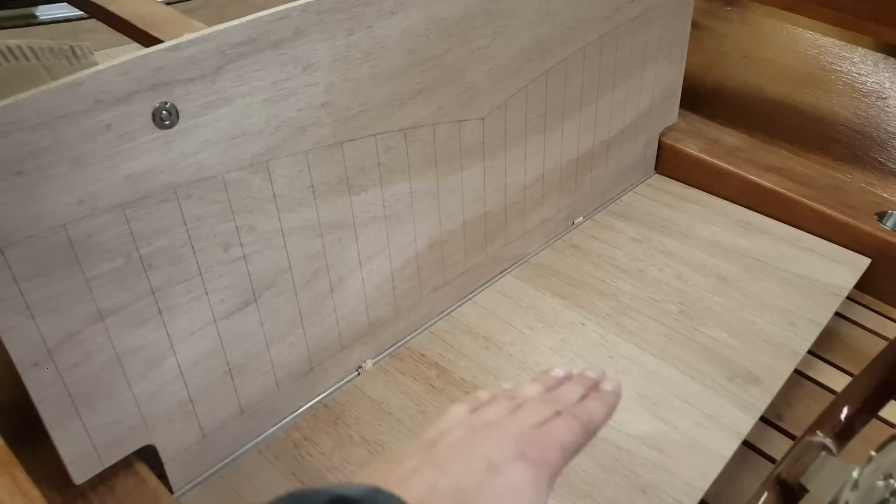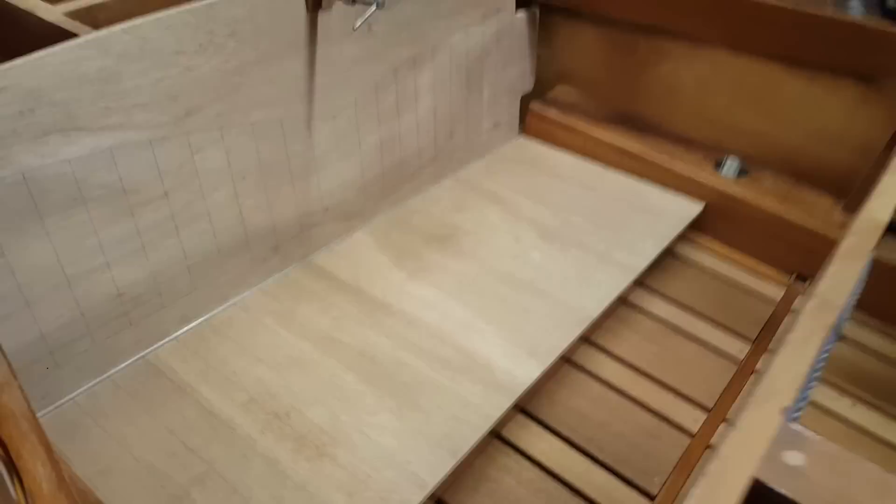You can see where it stops — from this point down there'll be nothing, and if I do this right the bottom of the seat will slip under the foam of the top. The bottom is super hard to see — let me get close — you can just barely see the pencil line. Same thing: I've laid out a two-inch pleated pattern, and the entire bottom will be that two-inch pleated pattern. Here's a look at the back seat — you can see the layout on the base here better with the two-inch pleats.